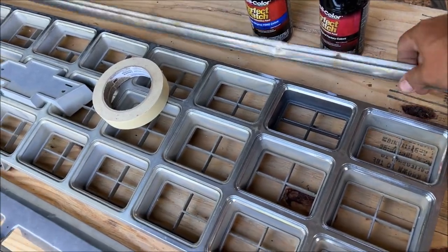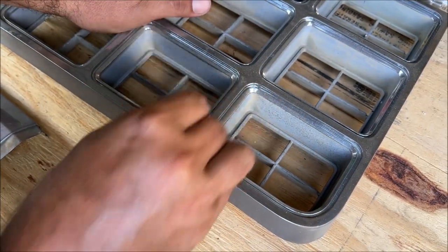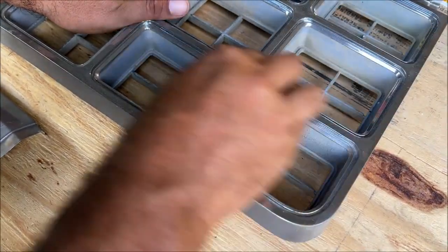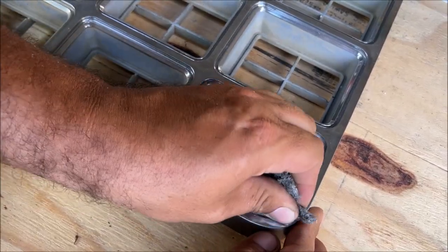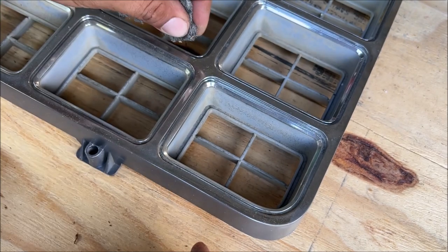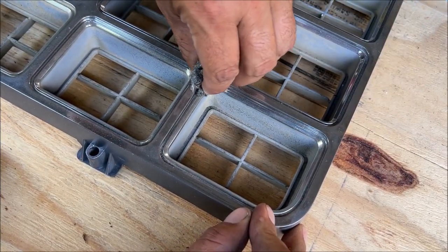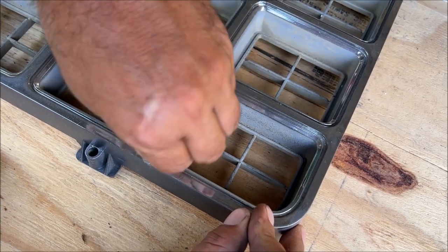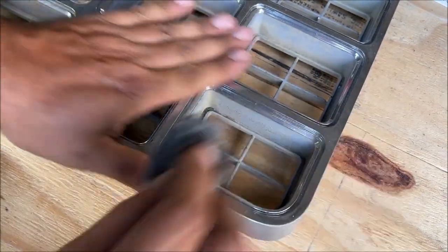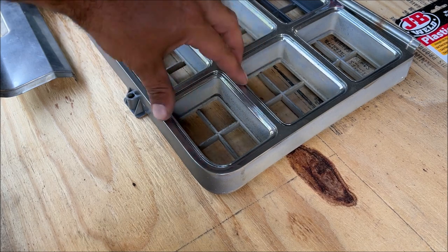We're showing a little bit of straightening and polishing. There are some dents, so we're taking quadruple zero steel wool and cleaning up the chrome. We have to get on the inside bevel, then make a little tiny piece and go inside the groove of each one of these squares — every single one. It's going to take a while to get that scrubbed out real good. The grill is chrome-plated.